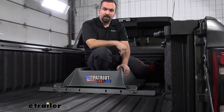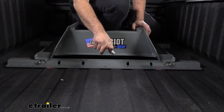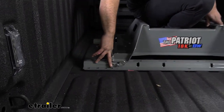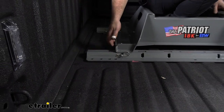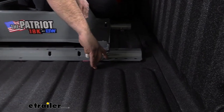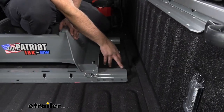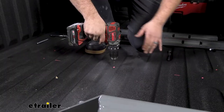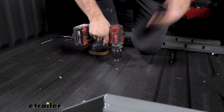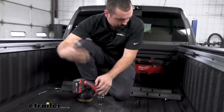The holes we're going to use on the rear rail are a little different than the front. Use the outside hole facing towards the tailgate and mark that one. On the driver's side use the inside holes — the furthest ones in. Take the rail off to drill. On the passenger side the rear hole is the inside hole just like the other side, but the forward one is the second hole from the outside — mark that accordingly. Just like the forward holes, drill these out with the pilot, get your brackets underneath, eyeball them, enlarge them, and then start getting hardware in place.